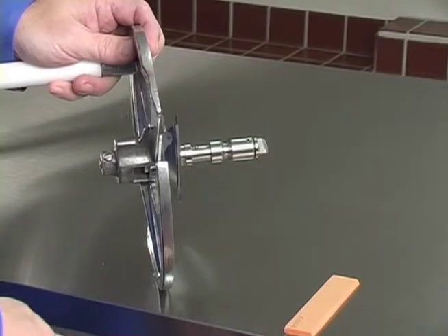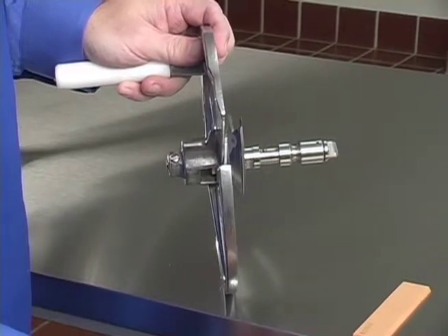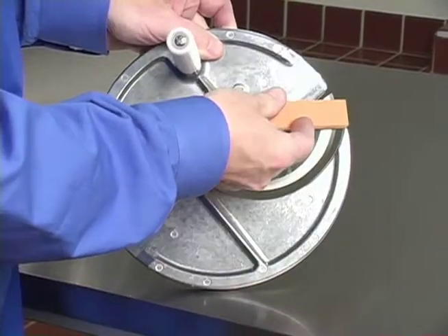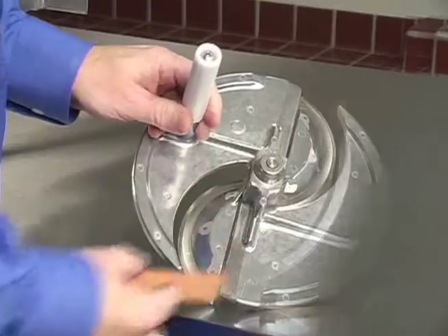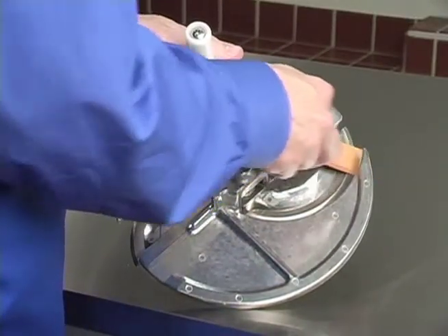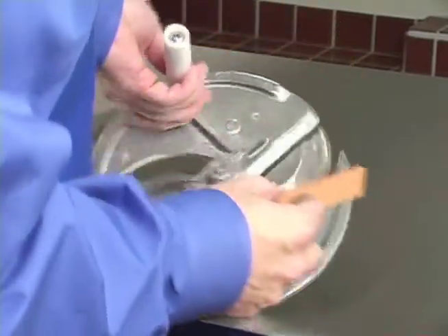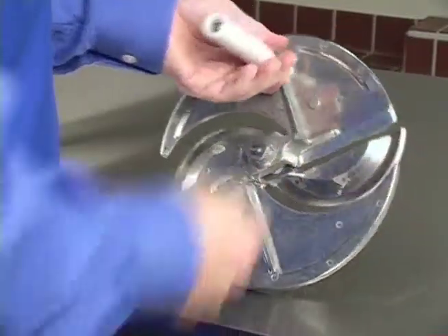To prolong the sharpness of your blades, they can be honed as follows. Remove the rotary slicing unit from the trough and leg assembly. Adjust to the maximum slice width. Use a fine honing stone on the beveled side of the blade. Move the stone parallel to the blade's grain and work along the curve of the blade. Be sure to maintain the original sharpening angles on the beveled side of the blade. If needed, use the hone on the flat side of the blade to remove burrs. A honing stone is available from Nemco for this purpose.